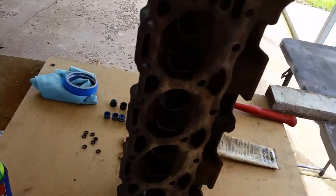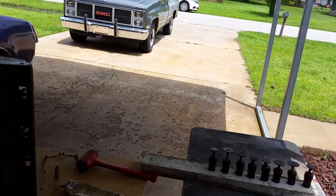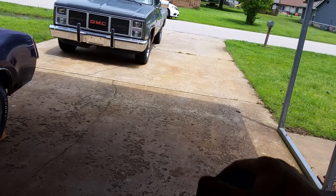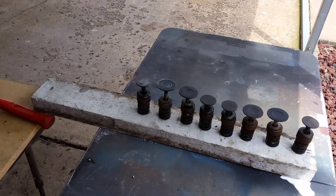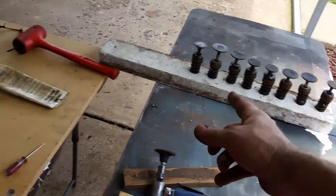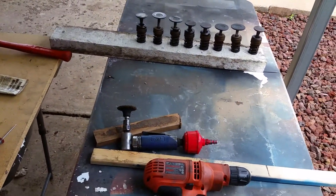I don't really care if this motor lasts six months — that's probably enough time to get my truck's engine redone. I think that engine just really needs valve guides, so I'm going to take those heads and have them rebuilt and check the bearings; I may just re-bearing and re-ring it depending on how bad it is. The problem is I don't have the correct valve springs for that cam, so I'm going to use the original 305 springs with some shims I already have. I know it's not ideal, but that's all I can afford to do.